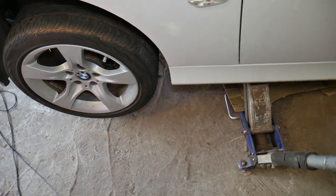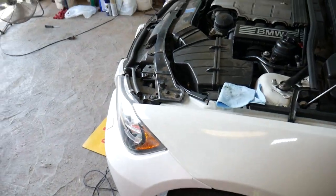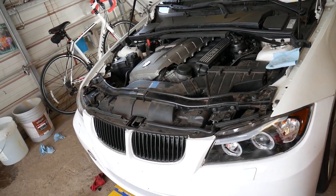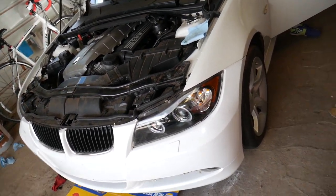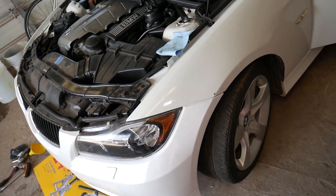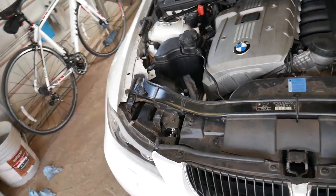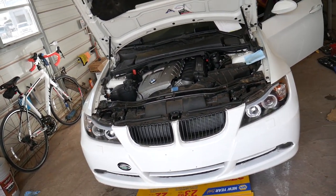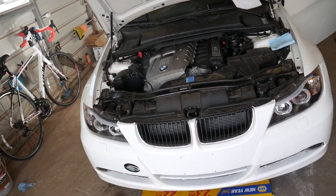Now we're going to go ahead and start the car and see what it sounds like. If it starts a little slow that's fine because we replaced a few gaskets and it may not have fuel in the system at first. It did start good. Now let's turn the steering wheel left and right — do we hear any noise? No noise from the power steering system. If you do hear noise, you need to jack it up again and keep bleeding until you don't see any air out of the system. Hopefully this video will be helpful — thank you for watching, please subscribe to the channel for more help, and see you guys next time.